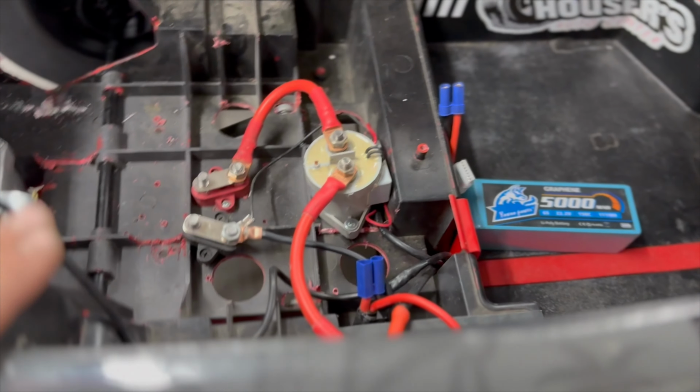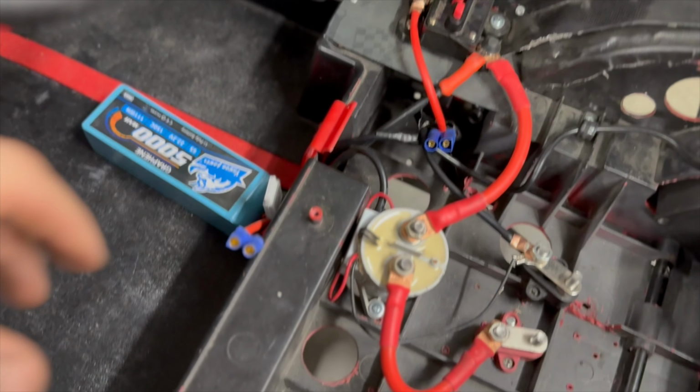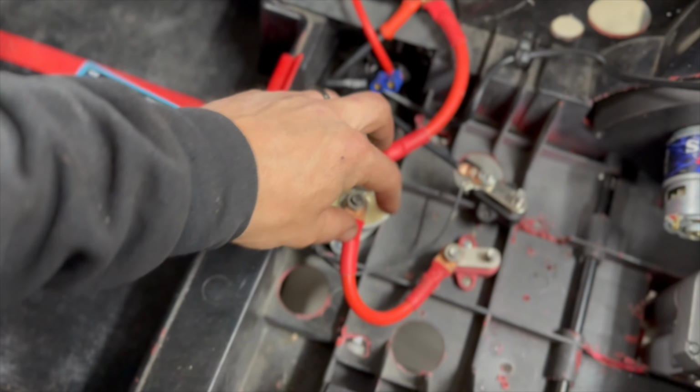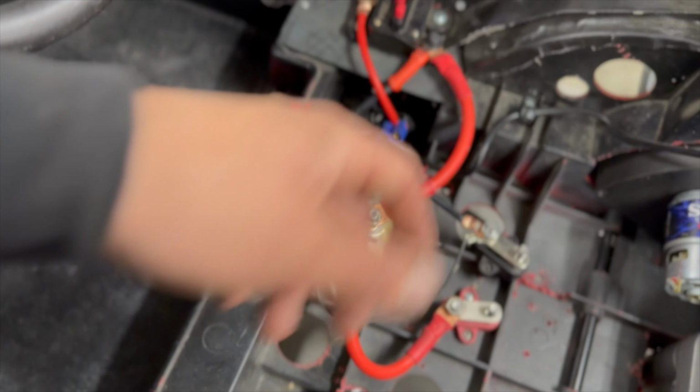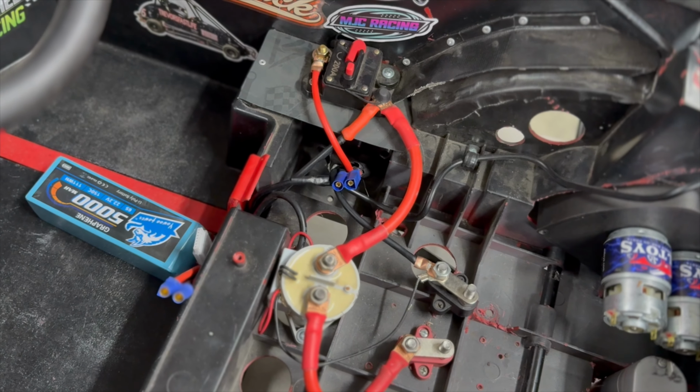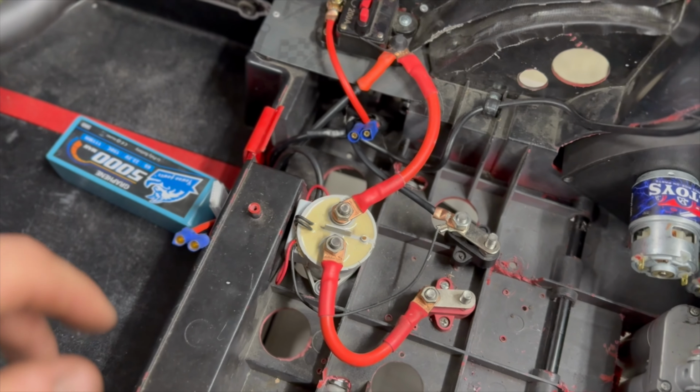But wire size, let's jump to that. So I know you guys see that little 6 gauge wire there. I think I'm going to actually take that off. I think it might be causing resistance because we have a couple different size wires on here. I think 6 gauge is totally overkill. Completely overkill. We've had 10 gauge on there, and Trevor's dipped into the ones on 10 gauge. We start going crazy and putting this thick wire on there, and now the car won't stay together.